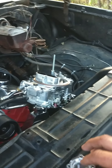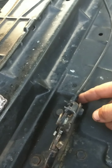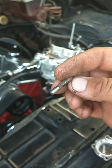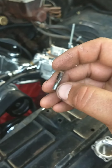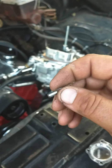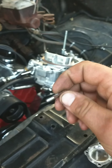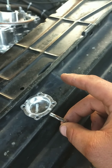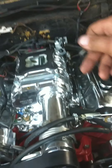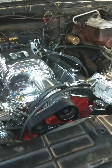I'm gonna drill a small hole here. Off of another old Holley carburetor I had, this is a vacuum nipple. I did grind the housing a little bit — the carburetor was junk, corroded, not even rebuildable, total loss — but keep it around for little stuff like this. Ground a slice in where it was pressed in, grabbed it with a pair of pliers, twisted her out, and that is what we will be installing right there. Then a line will run from the carburetor down below the charger where there will be boost, and instead of seeing a vacuum, it'll shoot pressure up a hose under the carburetor and open the power valve — so maybe I don't have so many lean issues.